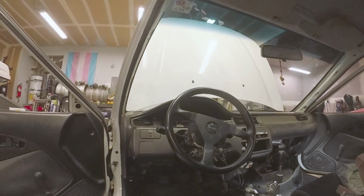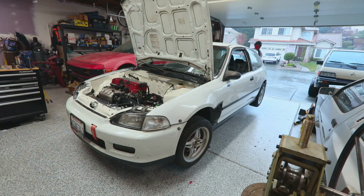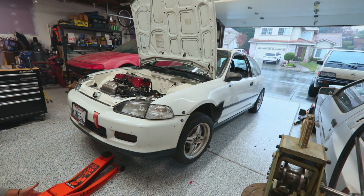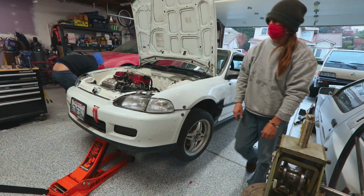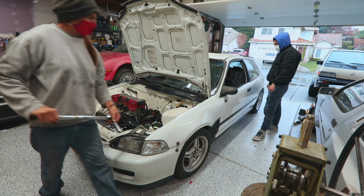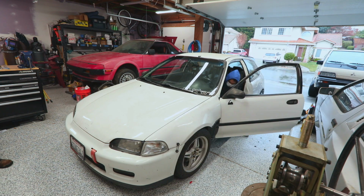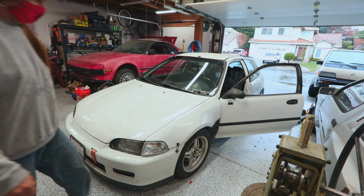Unfortunately, I didn't get a chance to shake down the car before handing it over. Immediately after getting the brake system all put together, one of the rear wheel cylinders ended up leaking and just hosed the brake shoes on that side, and I wasn't going to drive the car with soaked brake shoes. So when he came by to pick it up, he brought a new wheel cylinder and new shoes, and we put those in before he headed home.